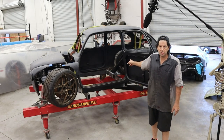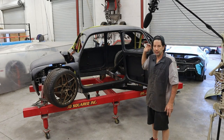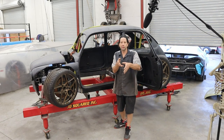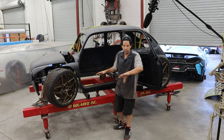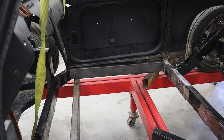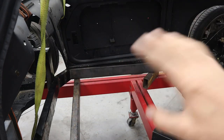Let's go ahead and zoom in to where everything ended up laying out. I don't think I actually showed that in the last video, and that's going to lead us to the next thing, which is basically I need hoops. This chassis is strong, but it will actually have frame flex right now because there is no triangulation. It's just kind of a straight ladder frame at this point. It obviously needs a lot of structural support still — I need some gussets, I need some hoops to kind of tie everything in.